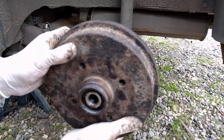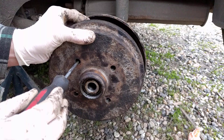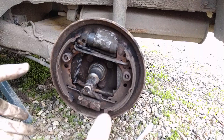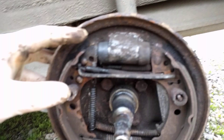That's what you need to do if you can't take off the drum. You take off all the bolts and line up this hole so you can get to the bottom of this lever here. You just lift it up a little bit, and if you do that the brakes are going to come in, so you'll be able to take the drum off. I'll just press on the brake a little bit now and you'll see.